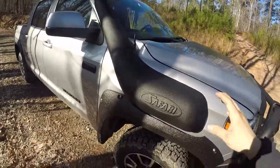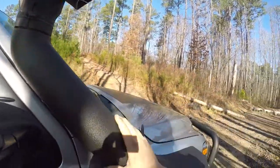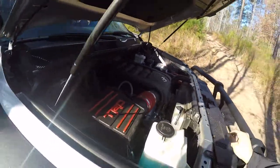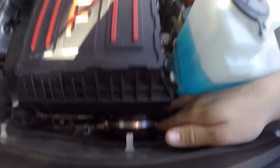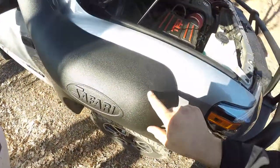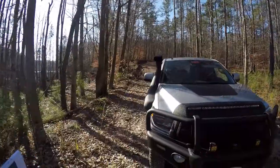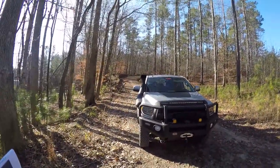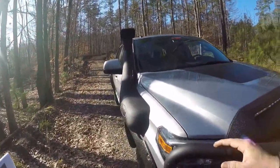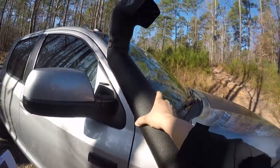That's basically it — seven bolts up here, three in the A-pillar. You can angle the head to the back if you want. With the TRD intake, a rubber pipe connects through the fender and it's completely sealed all the way to the throttle body. That's it for the Safari Snorkel. If you have questions or want more detail on the install, subscribe, like, and comment — I'll get to them. It fits perfectly to the contour of the body, it's solid, and it's not moving anywhere.